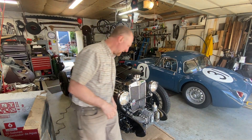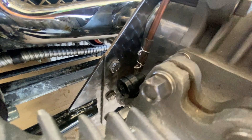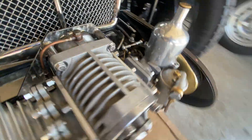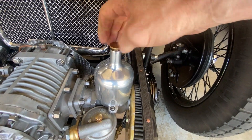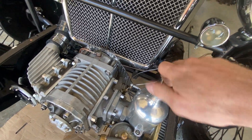The first thing I want to do is a pre-flight. Let me walk you through this. We've got the supercharger, there's an oil reservoir here, and there's a sight glass. We're looking for an oil level on that sight glass — you can just barely see it, right about there. We're about halfway up, which is appropriate because the fill line and the plug is about halfway up. So that's good. Let's make sure we've got some dashpot oil.